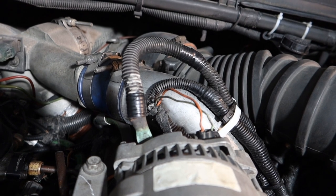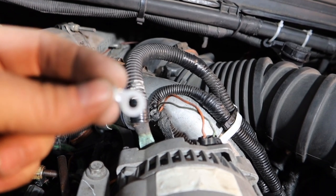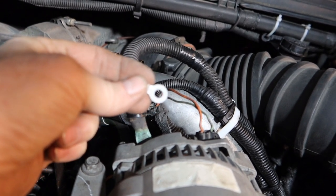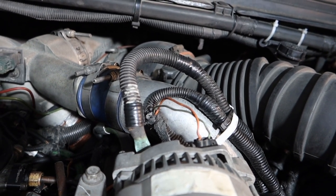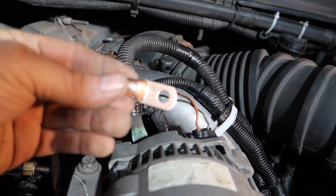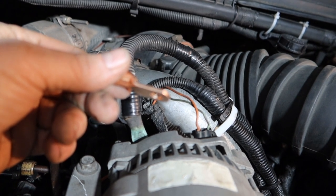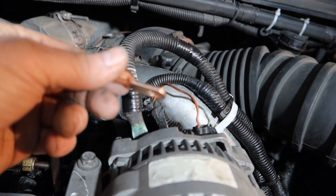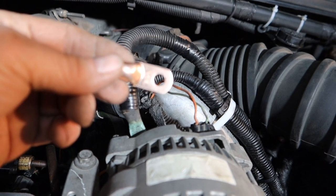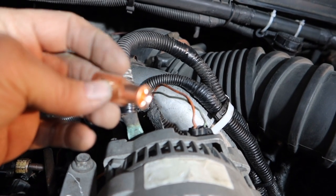And one of the things that you will need to start to replace is these little connectors that Ford puts on. It's just way too small and way too chintzy. What you need to upgrade first off is putting on a very large lug, and these can be gotten at your local automotive store in the battery section, or these right here, which I get for car audio installation. And these are much thicker, and down below in the description I will have information on where you can get these lugs as a complete lug set or singles, and they come in multiple sizes.